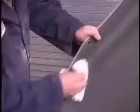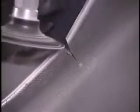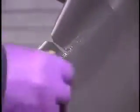When damage extends off the edge of the plastic, it is important to prepare as follows. Grind or cut a V-notch on the edge to prevent the damage from propagating later. Follow the procedures to dish out the area on the front side of the repair. Apply part number 06396 Adhesion Promoter to properly cleaned plastic.